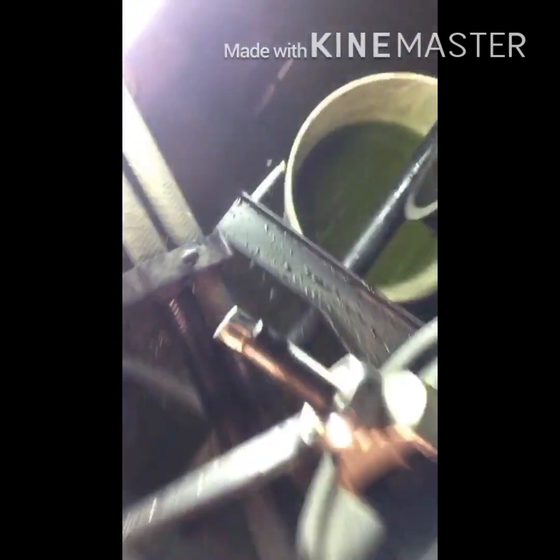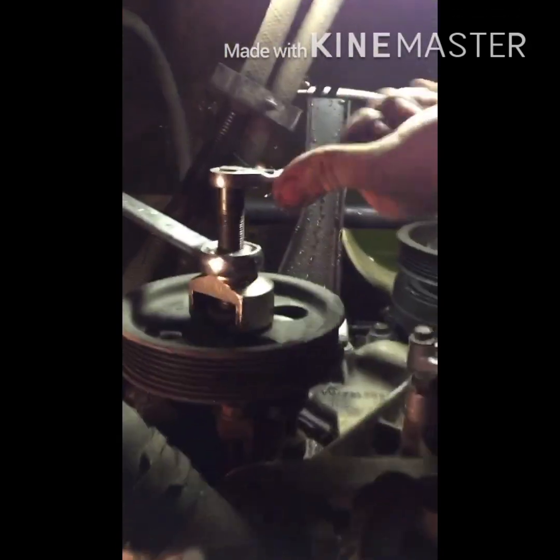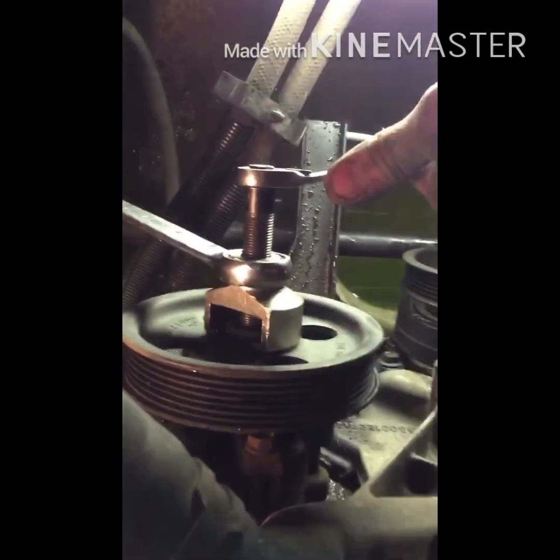So what I like to do is take my inch wrench, and I like to jam it up against the frame there, since it's a nice long wrench. I take my ratcheting wrench, stick it on here, and just keep wrenching away. Eventually it'll start popping and coming off. This one's starting to break loose already. I can feel it getting a little looser, and you just keep going until it's off.